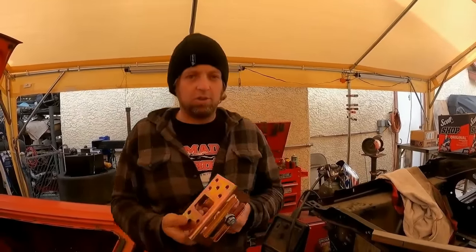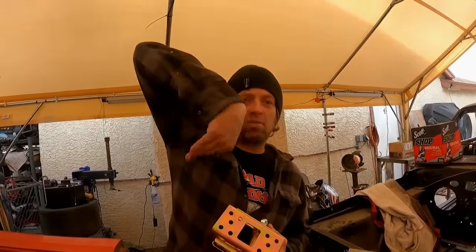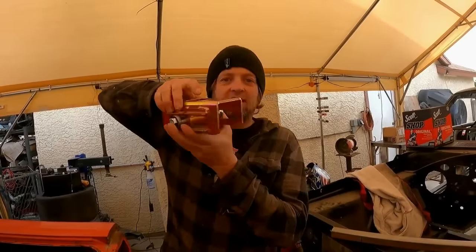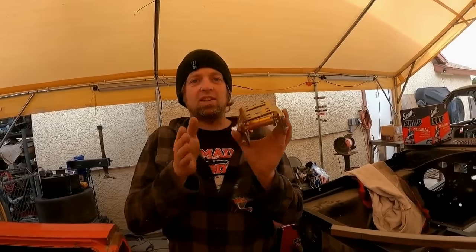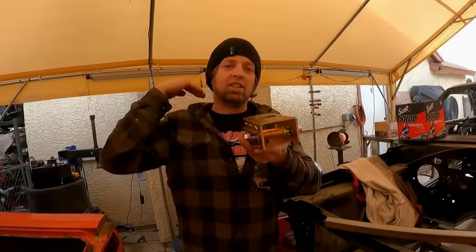But for those of you that don't know, this is what's called a leaf spring slider. So instead of having a shackle that swings with the expansion of the leaf spring, this slides. You notice the slide there, and it's got a bearing in it and all that. I like these because it takes away the leaf spring sway under the car. It makes it nice and solid and rigid side to side, but still allows for a nice, smooth, linear expansion